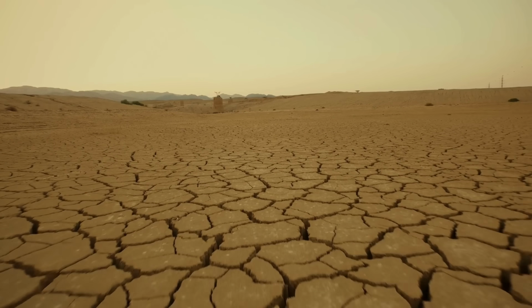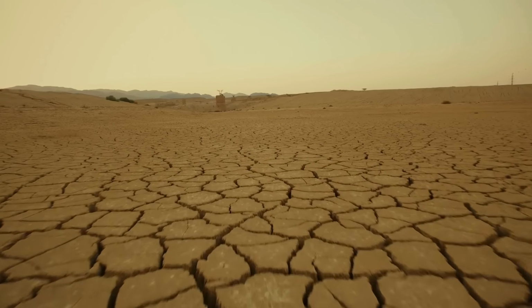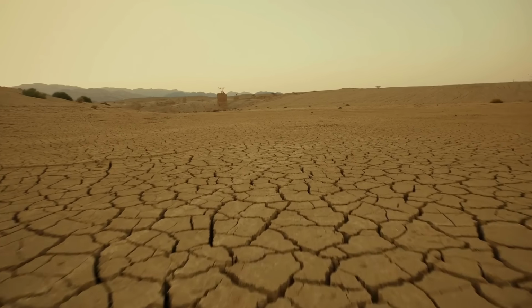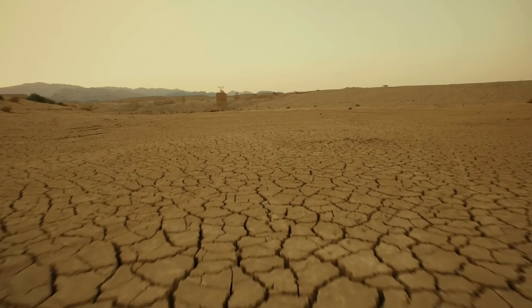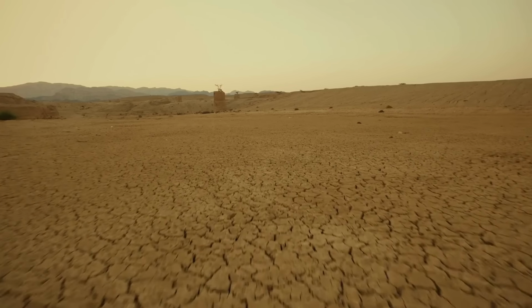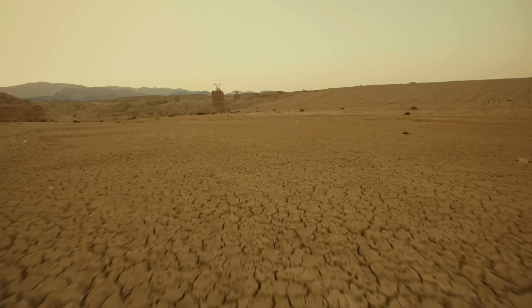Secondly, fracturing. Now, with all our coatings, be it the DIY or the C6 coating, we have silicon nitride in them. And silicon nitride is one of the ingredients that helps resist fracturing. And fracturing is very easy to understand. Imagine the desert floor. It rains in the desert floor. It's perfectly smooth. That's a freshly applied coating. Over time, it starts to crack, and those cracks are fracturing. And the coating is still on the surface, but because of the fracturing, it loses hydrophobics. And unfortunately, that's how people gauge the performance of a coating, the hydrophobics of it. But there's a lot of other things going on with the coating.